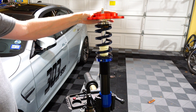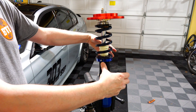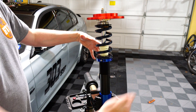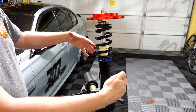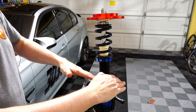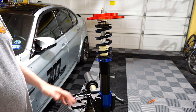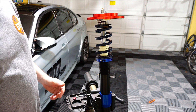Why do that? Well, if you're racing and you're in a turn, the car leans over to one side, loads the tires, and the outer edges wear out — your contact patch is not optimal because it's on one side of the tire instead of the whole surface. So you adjust the angle, you get better wear, better contact patch, and the car turns and handles better.